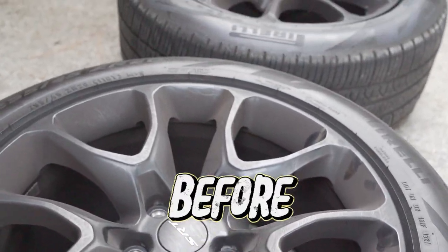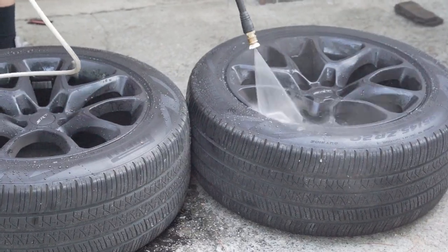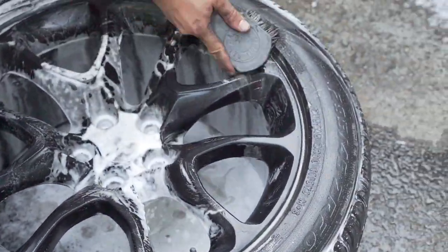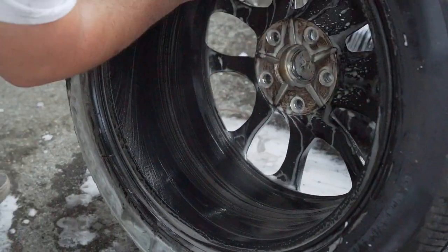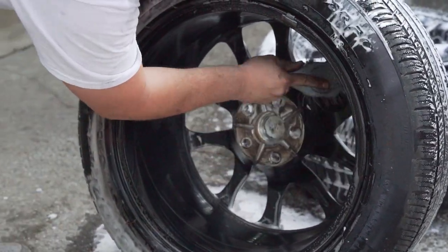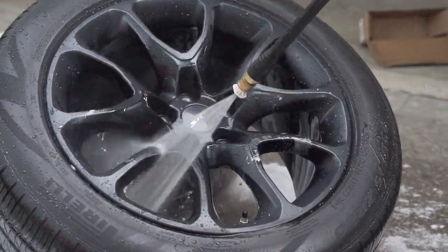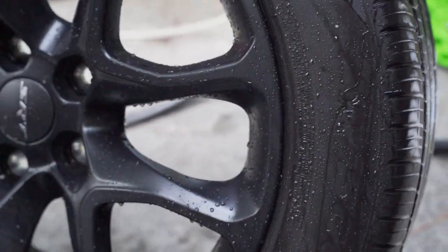All right, y'all, so another thing I want to talk to you guys about is, believe it or not, if you don't change these pads in a decent amount of time, I've seen, for example, BMWs, the M series, AMGs, Corvettes, mostly BMWs, they don't change the brake pads fast enough. And what happens is that beautiful M or Brembo or SRT starts disappearing. The clear coat starts chipping. The brake dust starts eating into the clear coat of the rim. Luckily, he caught this on time. He's only got maybe 5,000 to 8,000 miles on this Durango Hellcat. That brake dust is not gonna eat away at his clear coat. His rims are gonna last a lot longer. And he doesn't have to look ugly driving around with dusty brown brakes. So keep in mind that this is important for the quality of your vehicle, for the longevity.